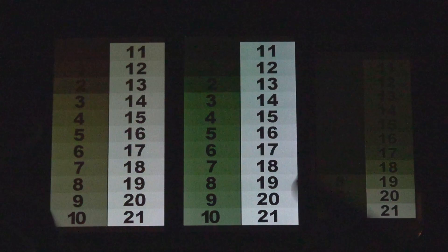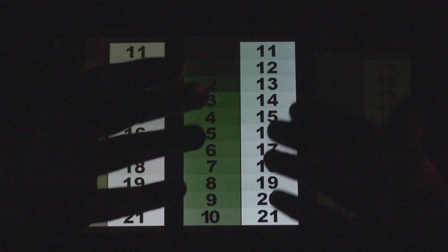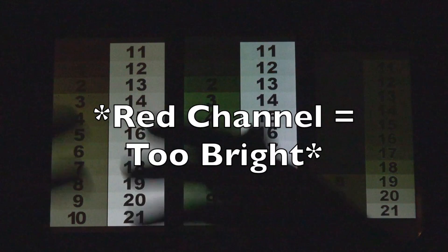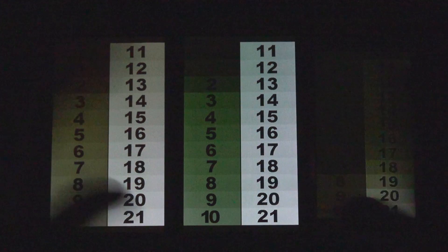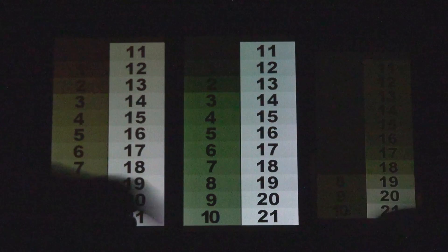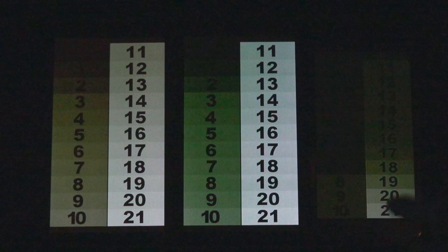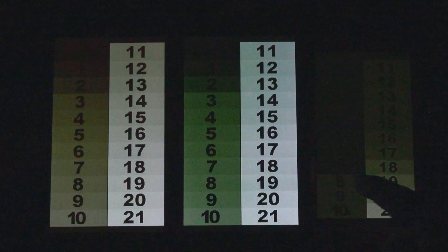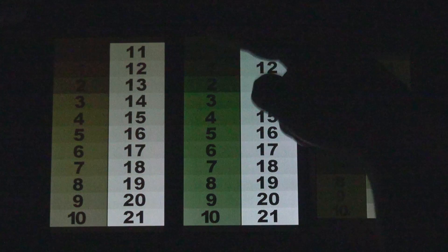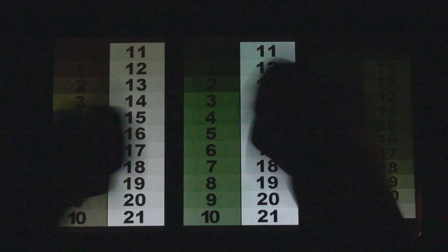So what you should be seeing is just a perfect gray going all the way down to black in stages. The problem is if you look at my screen, the green channel is just a little bit too bright — so you're seeing it favoring green. And on this side, the red channel is just a little bit too red, favoring red. That's happening in the factory as they're having different bits of calibration problems and not making it uniform. Now on the Galaxy S3, you can see it's actually clipping at 8. Whereas on these ones it goes 10, 9, 8, 7, 6, 5, 4, 3, 2, 1, and then zero is entirely blacked out. That means these displays have no black clipping, which is actually pretty awesome.